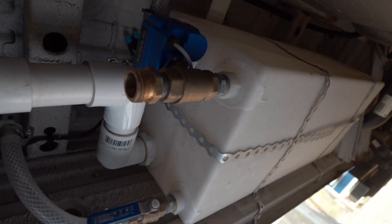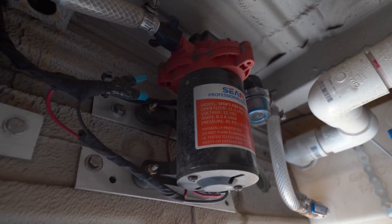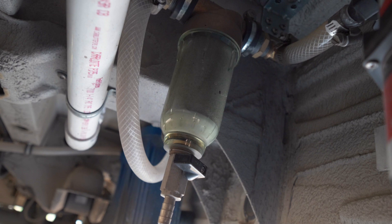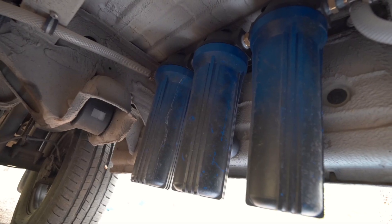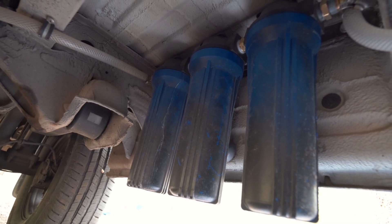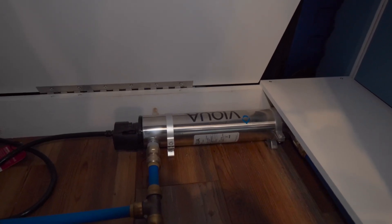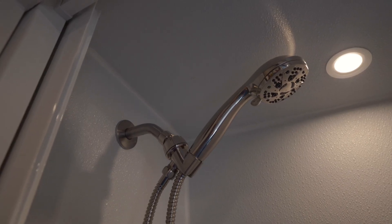So on to the overview. The system starts off with a 7.5 gallon water tank. From the holding tank, it goes through the pre-filter, the pump, and then through the accumulator. The first stage in the filtration process goes through a 50 micron spin-down filter. From the spin-down, the water gets carried to our three big blue filters — the first being a 20 micron filter, the second a 10 micron filter, and the final filter a 5 micron charcoal filter. The water then goes into the van through a UV light which kills bacteria and viruses, then comes out clean through the shower head, onto us, goes back into the holding tank, and the process starts all over again.